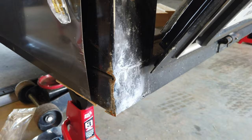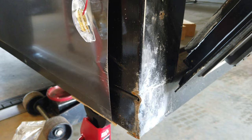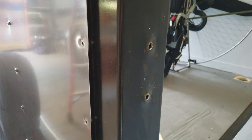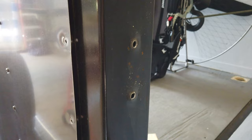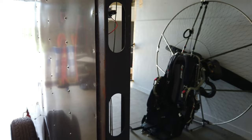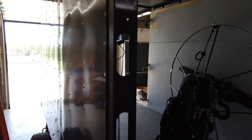I got the corner skin off. The frame is a little bent up there — I'm going to just get it back straight and grind it smooth. This is where the cam lock for the back door goes and it tore the bottom one loose, so I'm just going to straighten that metal back out. I'm going to replace them with stainless steel three-eighths bolts, three bolts on each hinge. The trailer comes set up for two tail lights but they only installed one, so I bought another set of tail lights and wires.